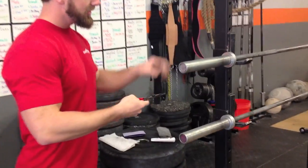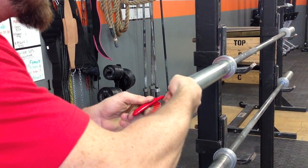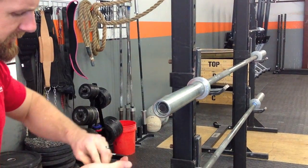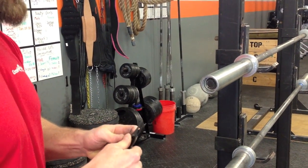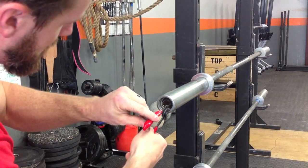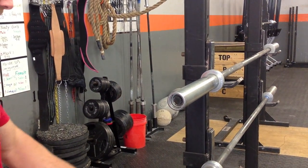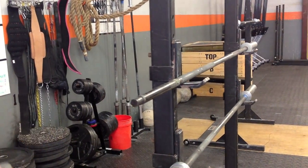All we're going to need is some snap ring pliers to get this outer snap ring off, and that's going to start our process. So I'm going to take this snap ring off. I take that snap ring out there. Now this little cap, I'm going to get it to fall off. Now I'm going to reverse my pliers and there's an inner snap ring that we're going to have to remove. So now this comes off and we'll take a look at what we've got here.